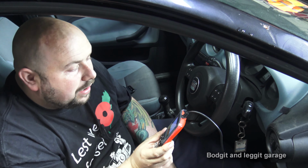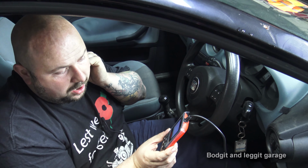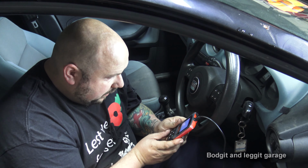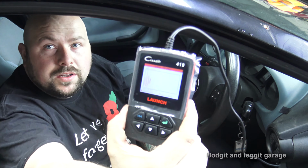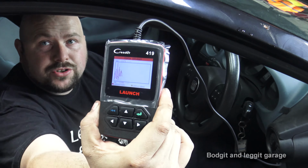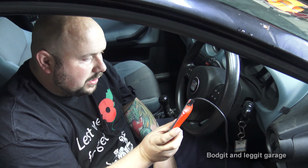Now we do have a heating problem with one of our O2s, where we're looking, it's our sensor 1, yeah, our sensor 1 heater isn't working, and you can see that because it's just zero. It's not moving at all, and it should be moving a little bit. It should be doing something even when the engine is cold.